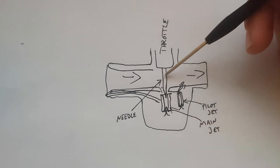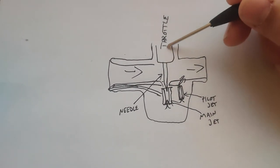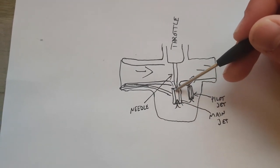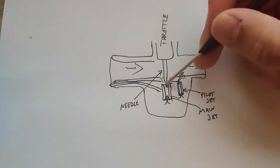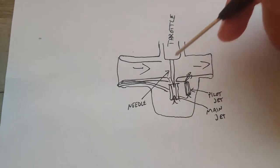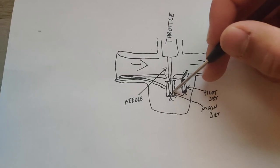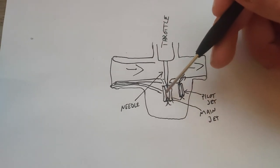Next is your needle, which is connected to the actual throttle. As you pull the throttle back and forth, it raises the entire needle in the body up and down. That opens up the passageway through your carburetor, and as the needle raises it exposes more of the main jet orifice, so the Venturi effect draws fuel up and out. As you get more than about three-quarter throttle up to full throttle, it's totally open — at that point it's all your main jet controlling the metering. If you're really lean or rich up top, you might have to upsize or downsize your main jet.